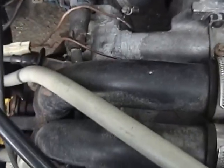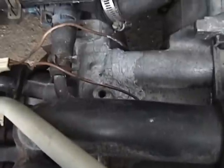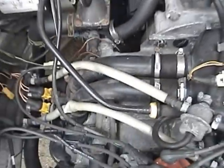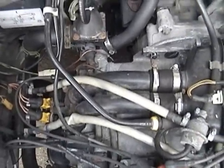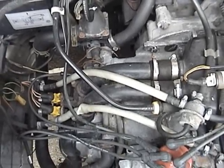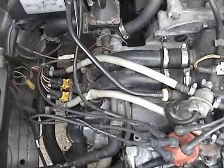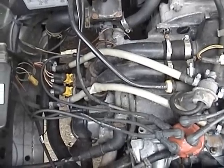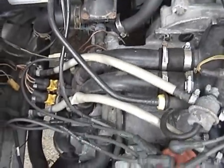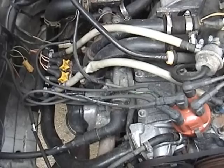I do have a leak at the outer water jacket gasket on the driver's side. I tried a whole bunch of stuff to patch this up — I cleaned off the engine and smeared it with gray silicone on the outside, which did not seem to do anything. I tried a couple of different brands of stop leaks. Thankfully I did not clog the cooling system; the van is still cooling just fine. But I certainly don't want to mess around with that anymore. I've dumped a couple of things in and it hasn't stopped the leak — it did seem to slow it down a bit.